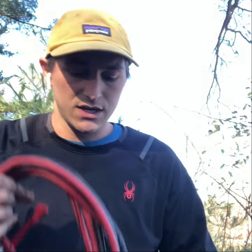It didn't work with just solder. I had to put a piece of wire in there. I think you saw the piece of wire, and that's what did it. I had to have enough, I'm guessing amperage. It had to be able to carry enough current across that wire, and what I was putting in there was not enough. It couldn't charge the battery through as small of a wire as it was. I used a piece of, I think it was 14, no, it was 12 gauge wire, I believe.